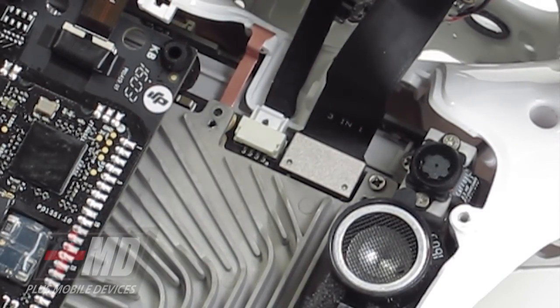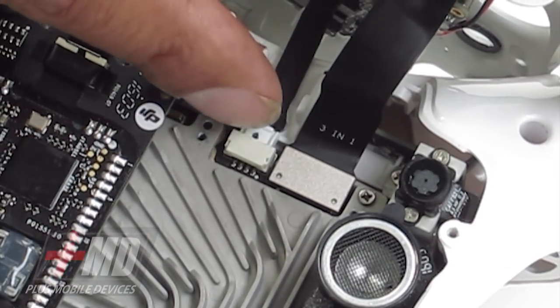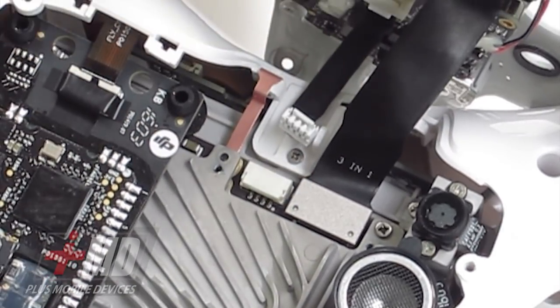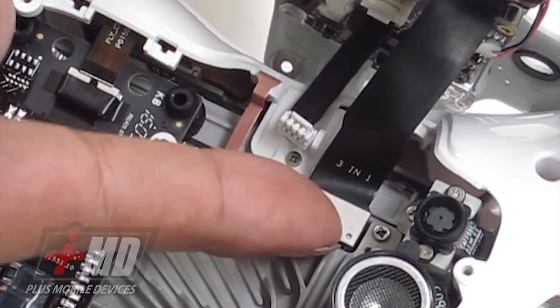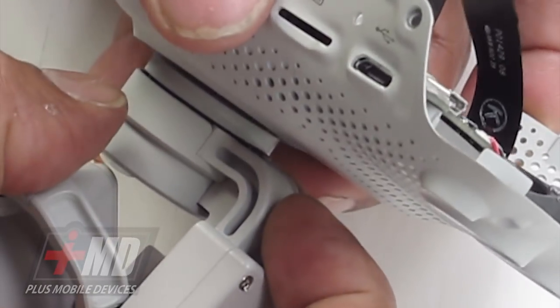So now we have a ribbon flex cable and a ribbon cable. Let's go ahead and take the ribbon cable off — press the notch here. This flex cable here has a connector; just lift it up and free the connector. Now this turns out of play. Now all you have are the gimbals. What we want to be doing is replacing this bad shaft with a new one. This is the new yaw arm that you can get from my website — the link is below. What we need to do is separate the cable here.